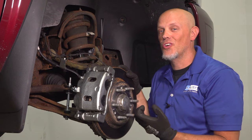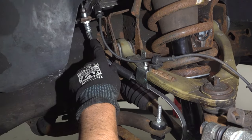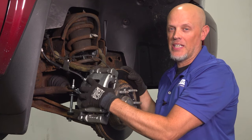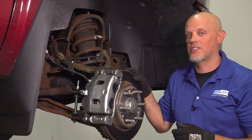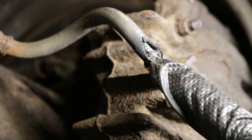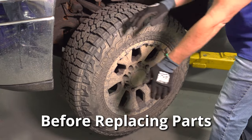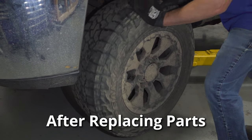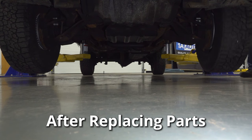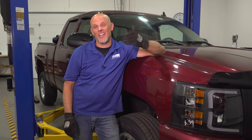The last thing we're going to talk about, which is often overlooked, is the brake hose itself. That's going to give you very similar symptoms to the other components. The brakes will be engaged even after you release the brake pedal because fluid is not able to go back up into the master cylinder. If there's a clog in there, it's just going to hold it tight — there's going to be pressure down there holding the brakes on. So if you have abnormal brake wear, you don't want to replace just the pads and rotors or you're going to have issues down the road.